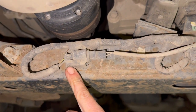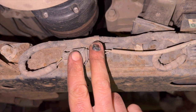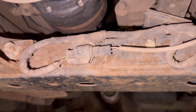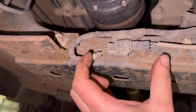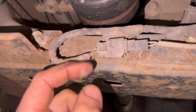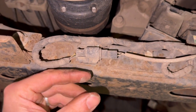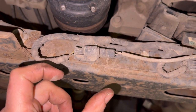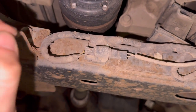I'll put a link to any repair plugs in the description below if there are any aftermarket ones I can find. You could find a generic waterproof plug and just cut there and cut there and join it up. There's also the option to hardwire it and just join the two together. I'm going to separate the plug, see if I can get the pin out, see if I've got any spare pins, and work out the best approach for repairing it. Once it's repaired we'll check the data reading in the car and see if it's reading correctly — then we'll know it's going to fix the fault.